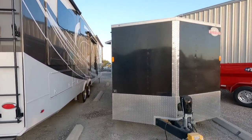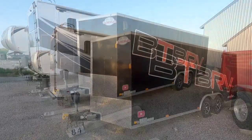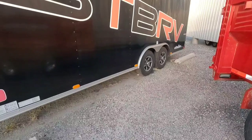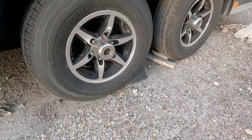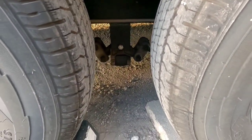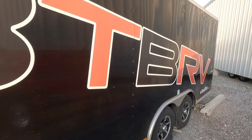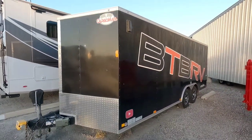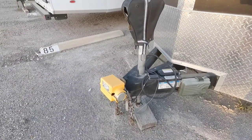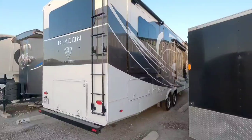When we're done, we're going to hitch up to the Cargo Mate trailer we have here — the one and only BTBRV Cargo Mate trailer. We did a lot of upgrades to it including nicer aluminum wheels versus the steel wheels that were on it, Goodyear Endurance tires, upgraded the equalizer from a standard steel equalizer to a Dexter Easy Flex, put thicker shackle straps and greasable wet bolts on, branded the side, completely bedlined the inside, added lighting, wired it up with batteries, and put on the Ultra Fab Phoenix 4000 tongue jack.